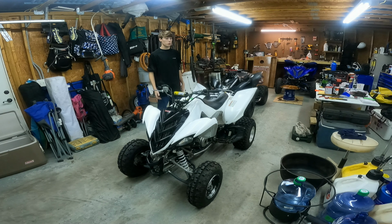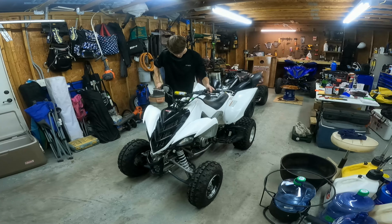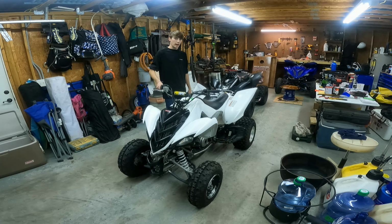Today we're going to be installing a new steering stem bushing on my Raptor 700. Last video we got the case saver, chain slide, brake rotor, and we talked about the AIS delete kit that I bought. This video, like I said, we'll be installing that. I don't think I can get to the bottom bearing today, just because you need a special tool. I've seen other ways to do it, but I don't know if I have the stuff here to do it. So yeah, replacing it just because this one is completely beat. I don't know if you can tell, but it's got a little movement in it. So yeah, let's get straight into the video.